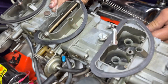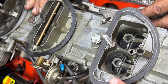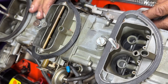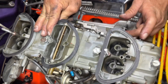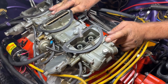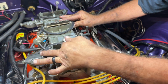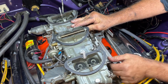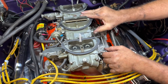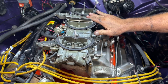You can see them opening right there as they're going — opening and then closing. These outboard carburetors just work off vacuum. What happens with the fuel in the bowl of these outboard carburetors is it will ride up the venturi and you'll see it spray out on these two guys here, right out the venturi. You can see all six of them doing it at that point.